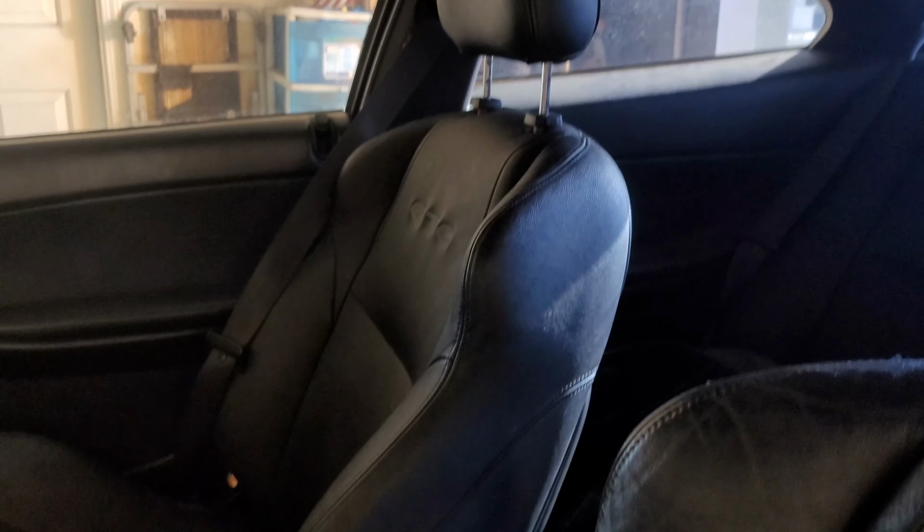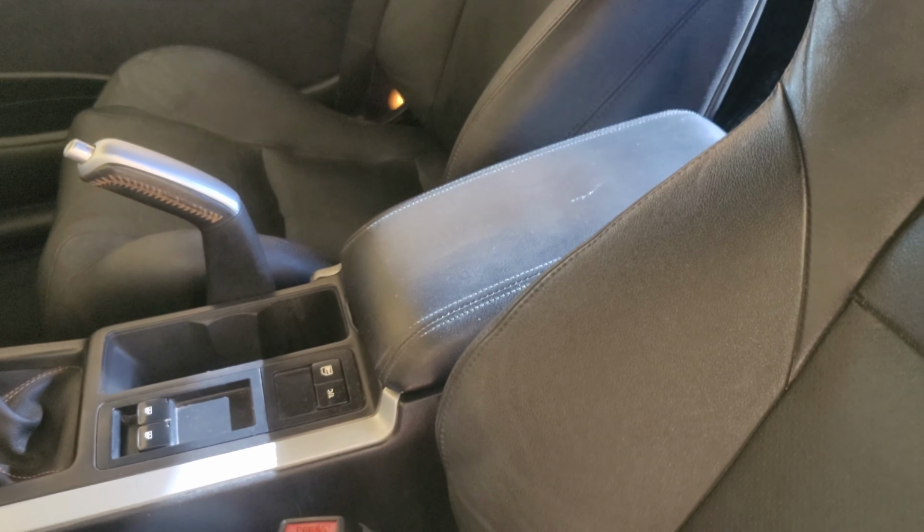I've actually got some really good zip tie stitching here. But I think the seats are gonna go. I mean, as much as I love having a nice stock interior, they're gonna go. Along with the back ones, I'm just gonna do a rear seat delete, which means taking out the seat, that centerpiece, and putting something in there, maybe like a felted piece of really thin plywood, cut it, make it look nice, put a floor down here so I can actually carry some stuff. That'd be cool.